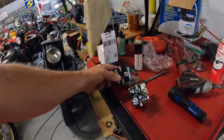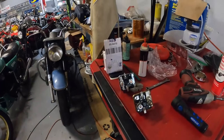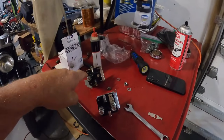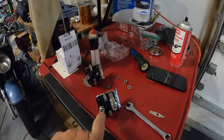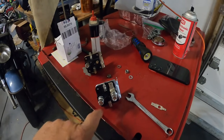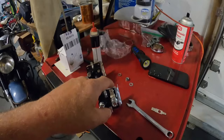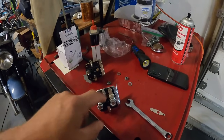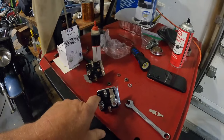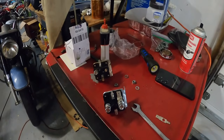They're different. When you order genuine replacement parts, you don't expect to find small differences. I switched the terminals around. These are electronically the same except that one side is on the hot side to the battery and the other side runs to the starter. I'm guessing this is a tab - an extra hot terminal that goes somewhere - because it wouldn't make sense to have it on the starter side. That must be the battery side.